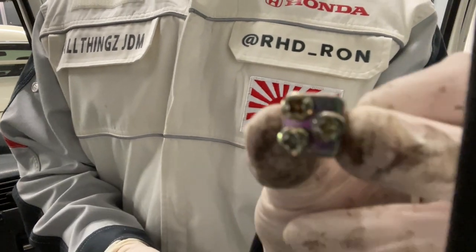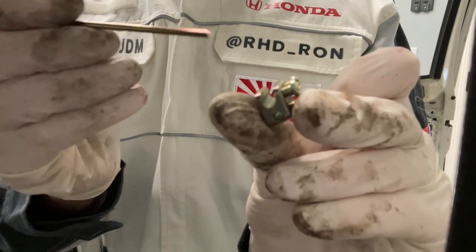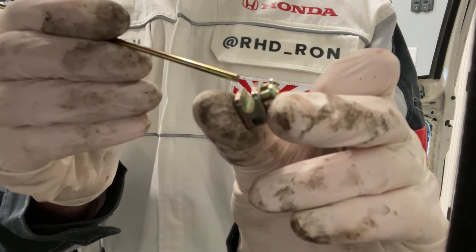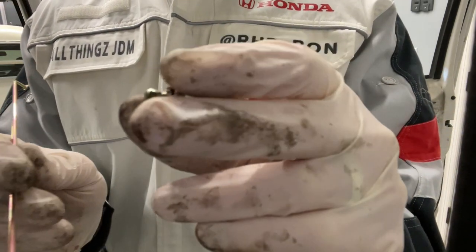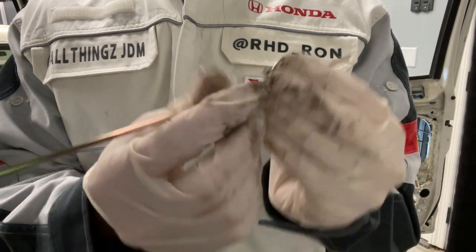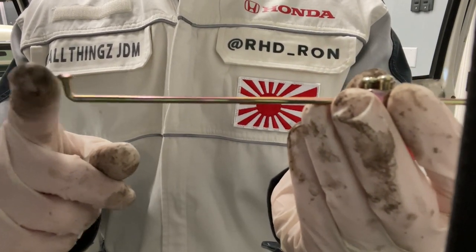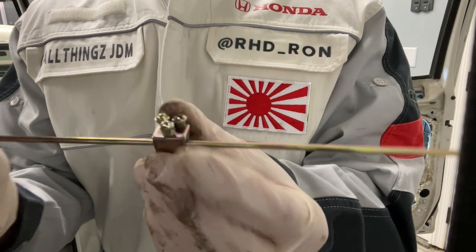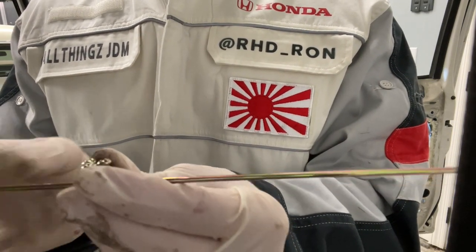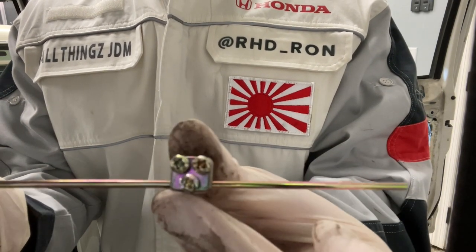The kit comes with this little connector piece — there's a hole in the top and a slit on the other side. The slit goes on the rod that's installed in the door. The other rod goes in the other hole, and you set the travel with this piece. It goes through your actuator solenoid, then you set it where you need it and screw it down to lock it. On the passenger door I ended up cutting off about half of it because you don't need all of it.